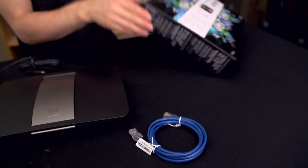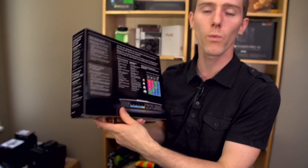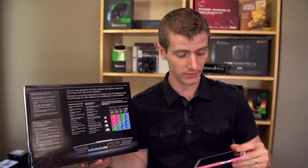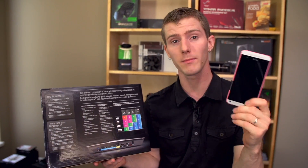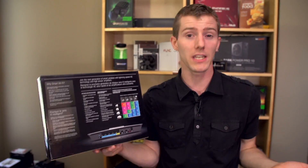So why are we upgrading to the EA6500? The answer is pretty straightforward. Number one is that it uses wireless AC. So if you have any devices that are able to leverage AC — for example, I have an HTC One — you will potentially see some speed benefit there. Number two is the fact that it's simultaneous dual band, so 2.4 and 5 GHz means that you have the potential for maximum range as well as maximum throughput.